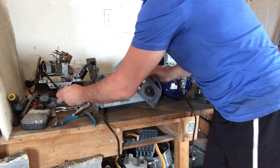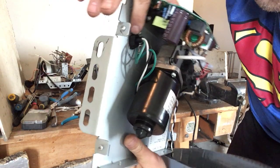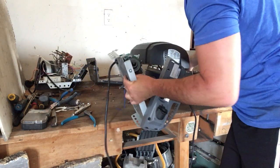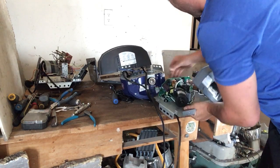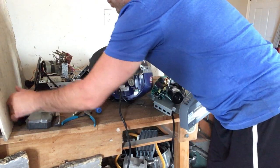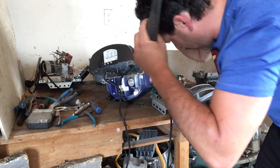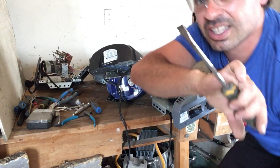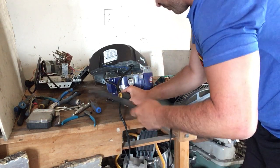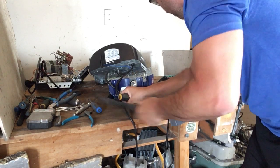This one I'm going to look at first. The first thing it has is a really nice appliance wire. Someone asked on a video how to remove it from the casing without just cutting it — they want to get the whole thing. Very easy: I put it up to my vise for support, take a flathead screwdriver, and I'm going to break that plastic with a hammer. I'll put my safety glasses on to remove the entire wire. I put the large flathead up against that plastic and I crack it, get it under, then take it from the top — crack that plastic. It pops through, and now I just cut it because it is already fed through.